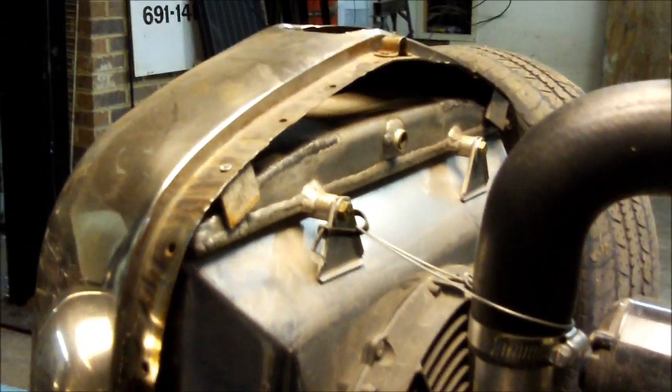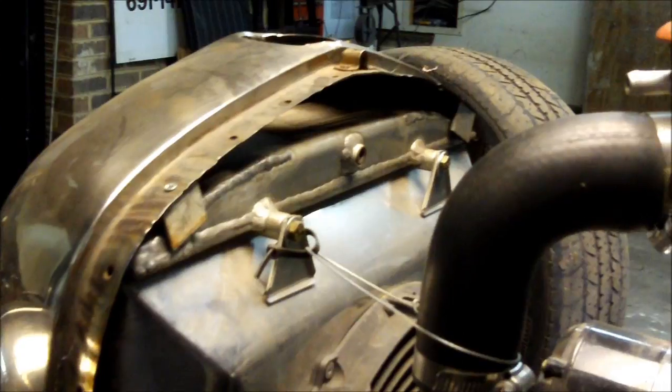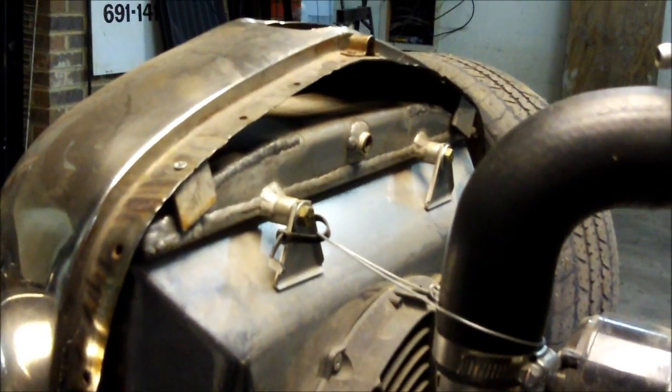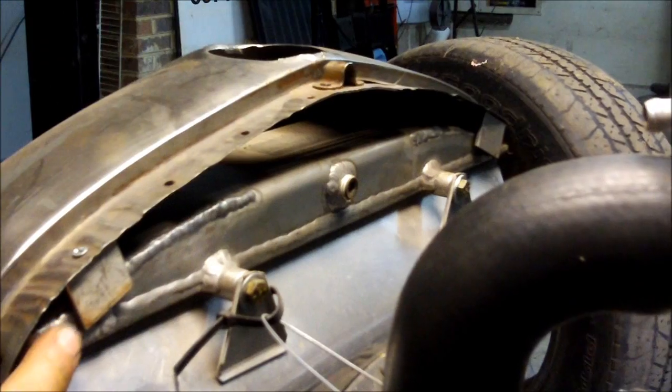And around the front, I didn't mention the radiator at all. It's a Be Cool radiator that I got off their eBay outlet, and it was damaged, but it was just some of the fins were bent on it, and it's going to get used anyway. So anyway, I had to cut it down. It's a double pass. I had to cut it down to fit in here, because otherwise it would have been like sticking out up in this range. And then in the bottom of it, it's hard to see, I had to notch it for the tube.